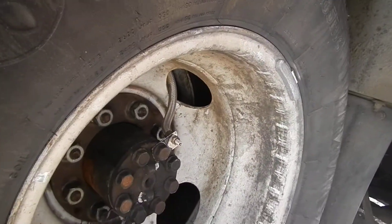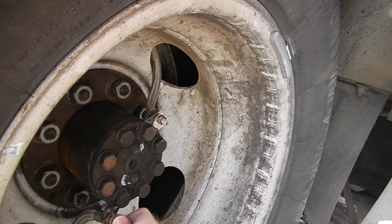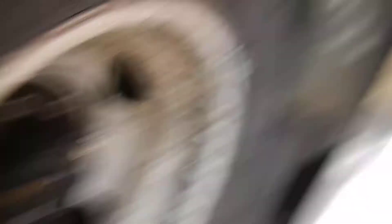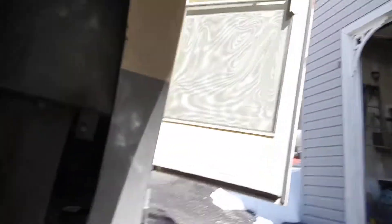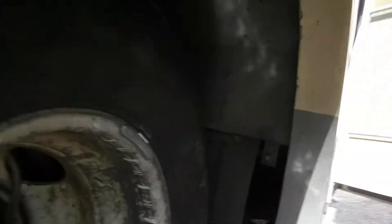We're a little low on the bottom still, so a bit more air. By the way, these tires are rated at 80 pounds pressure so I'm setting them at 75 pounds for the sake of having some leeway. All right, so the tires on the rear are done. Put your valve stem covers on — these are the plastic black valve stem covers you see on most normal vehicles. No need for any fancy work here. I have the trailer valve checkers on the front — I can use those on any of the valve stems throughout the whole motorhome.